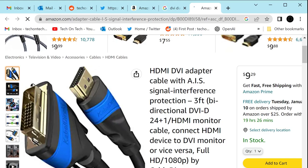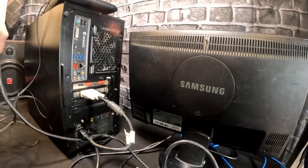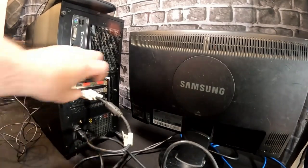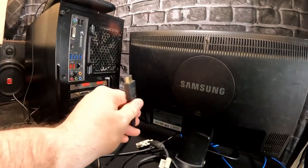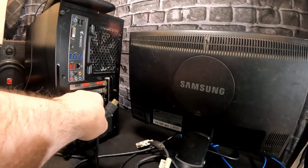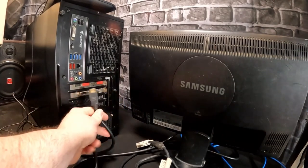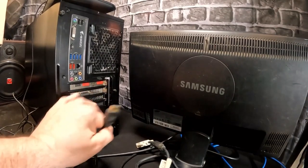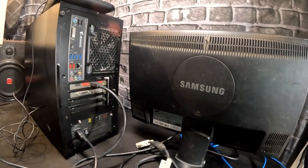That's typically how you connect DVI. So you can either do VGA, DVI, which is the preferred method, or HDMI, which is like the kind of plug you find on the back of your TV, and is also the cable I'm actually going to plug in now, because that's the one that goes into the TV capture card I have. In fact, this has DVI on it, HDMI, and DisplayPort, which is the fourth and final connector. So I've actually got all three. So VGA first, DVI second, HDMI is usually the third and preferred connector. That's the one I'm going to actually use on here. And then that will get you video.